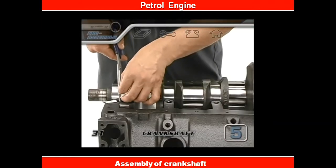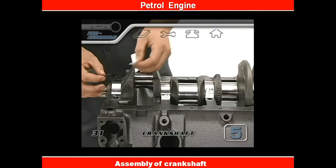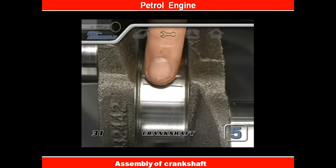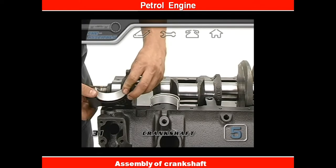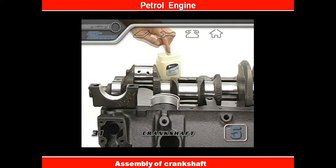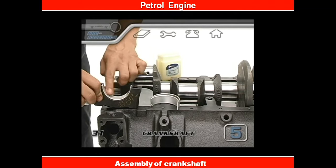You want to cut these strips the same width as the main journals of your crank. Don't tear them with your fingers — you could flatten the strip and get a bad reading. You should use scissors. When you open the wrapper, you'll see a little sliver of plastic; that's the tool. Lay one strip on each of the tops of the main journals of the crank. Clean the caps and install the lower bearing halves. Remember the block is upside down now, and the lower halves are the ones that go in the caps — they're the ones that don't have the oil holes. It's helpful to use a little touch of petroleum jelly. If you wipe it really thin on the bearing where it's going to touch the plastic gauge, it'll help keep the plastic gauge from sticking to the bearing.